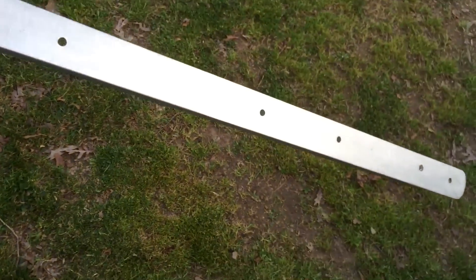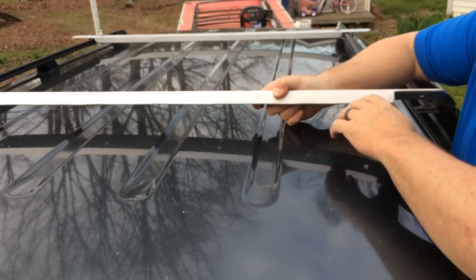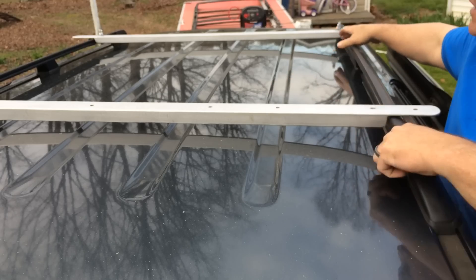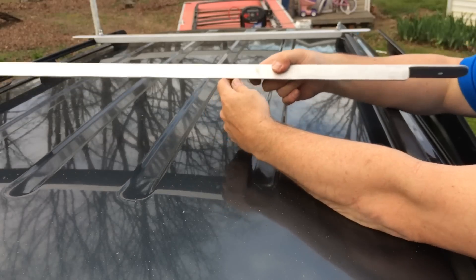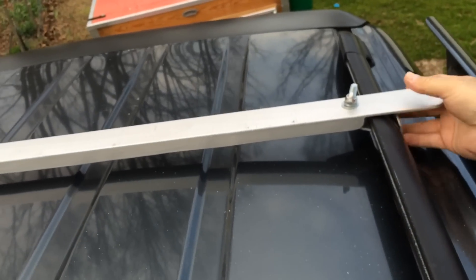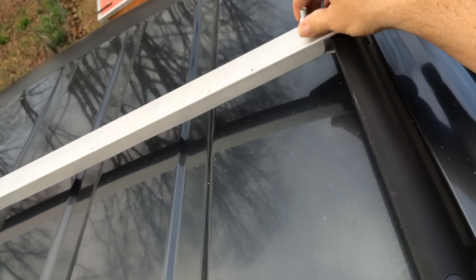That's the aluminum I took it out of, and here is what I ended up with. On this particular model, the 2003 Honda Odyssey, the front of the side rails is wider than it is at the back — further apart between them. So I had to make some adjustments on the front cross rails, or crossbars. You should be able to see how I have the back — it just has a piece that goes under and grabs the side there — and I have a bolt and a wing nut.